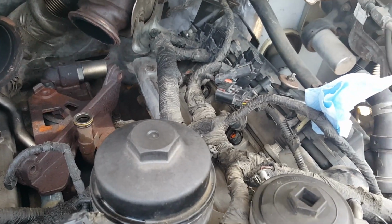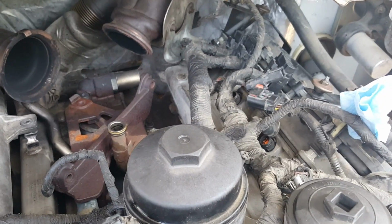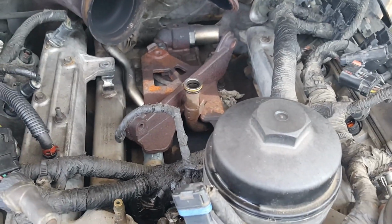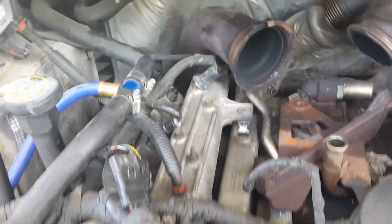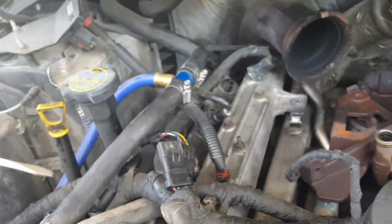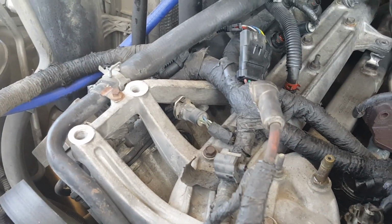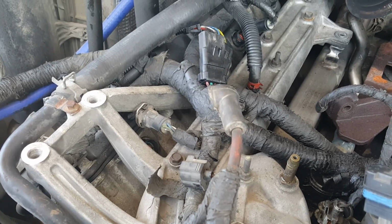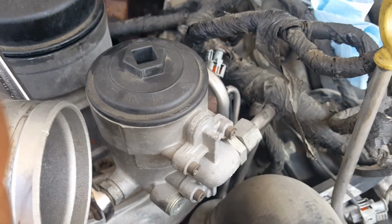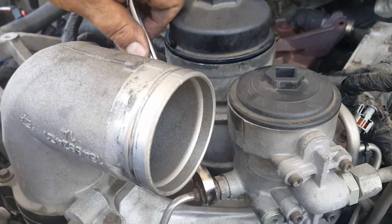This whole side, the driver's side rail, all 4 of them came out pretty easily with just the use of a 1/4 inch small flathead screwdriver. That same screwdriver was used for the passenger 2 rear ones, and this 6 inch, a little bit longer, to reach under this whole assembly to unlock the wire.